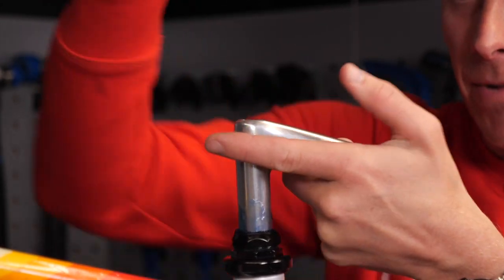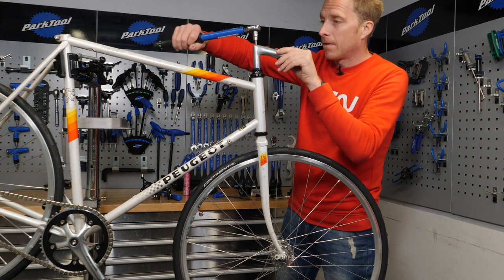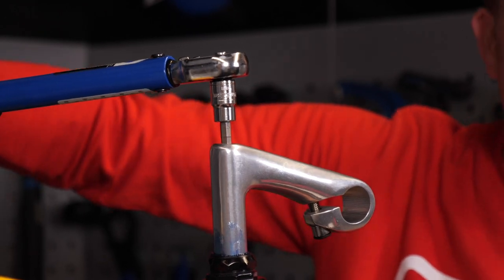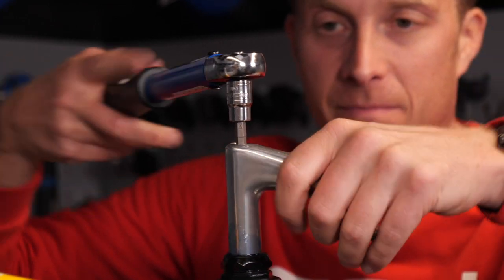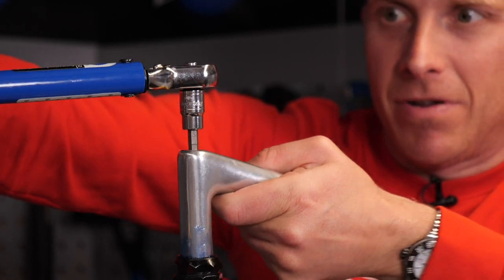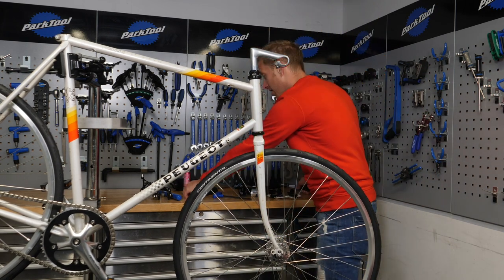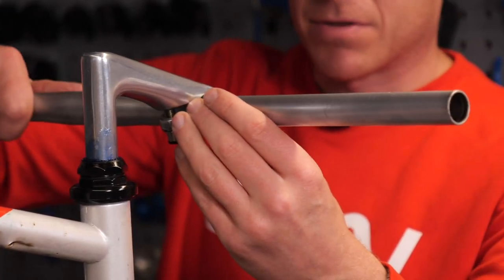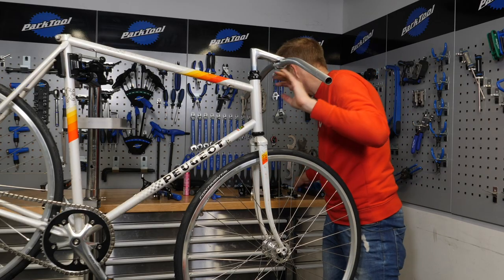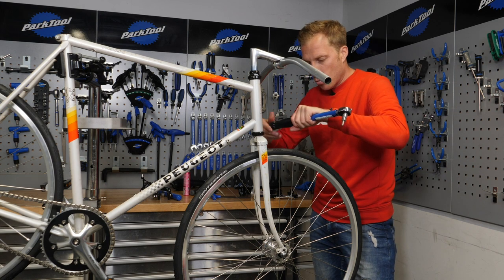This stem is like an old-fashioned looking thing, but it can't be that old because it does in fact have on the top of it a torque setting — it's 22 Newton metres. We'll just tighten that up, just in case we forget to straighten it further down the line. As you can see, I didn't really do up the front wheel either, so it just had a little slip out of place, but let's just pick it up. You forget how tight you actually had to do up these things. Good — there we go. I do like a stem like this. I reckon it's going to be slammed all the way down, trying to look as cool as possible.